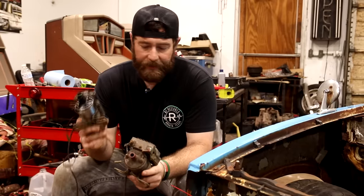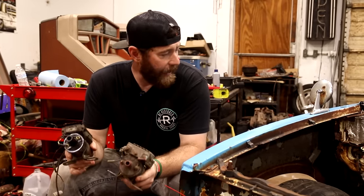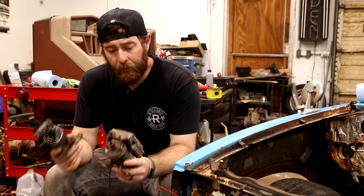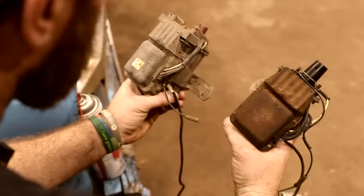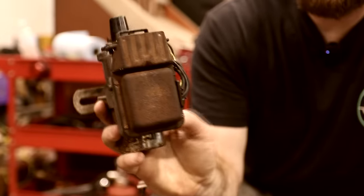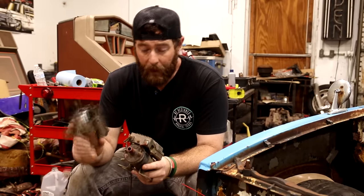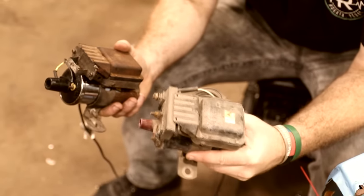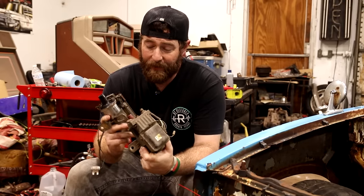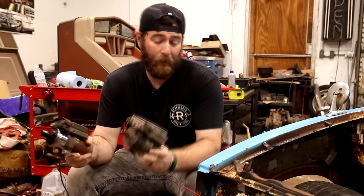So on this old truck, it seemed like we could get it to crank up, but shortly after I would let off the starter button, it would die. We tried to chase some wiring around just to see what the issue might be, and I'm pretty sure we narrowed it down to being this ignition module, igniter it's called. So on this truck, this is our original one that they had mounted on the firewall. Finding these parts for this truck is almost impossible, so we were able to find this one on eBay, and they're proud of them. I'm not even going to mention what we paid for this setup, but I can let you know right now, we're already in it higher in parts than what we paid for the whole truck.